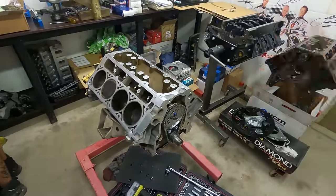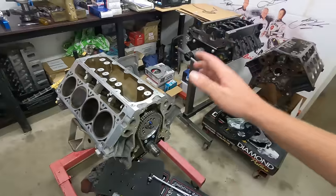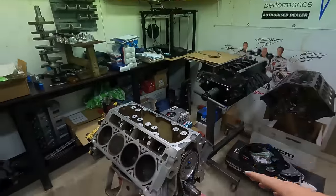This is where we're at, where Bo's at with it. We did have a lot of issues getting this engine out of the wagon. Story is, it's apparently an ex-Highway Patrol car from New South Wales. I've got a feeling it must have been somewhere near the beach, because a lot of the stuff in there was corroded. The dowels that locate the engine to the gearbox bell housing were actually really, really seized in, and it was really hard to split the engine from the gearbox. That was really difficult, but we did get it out.